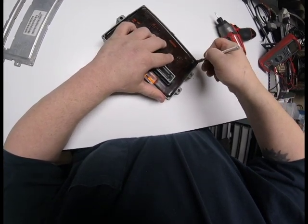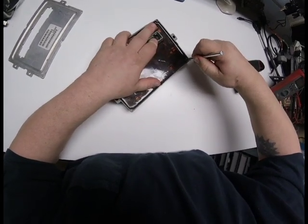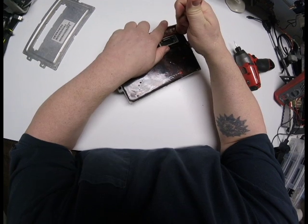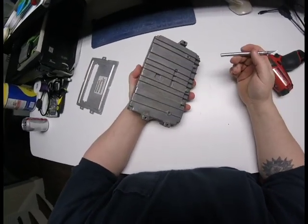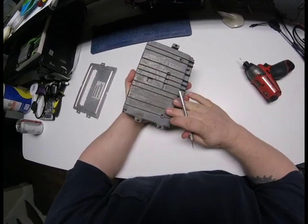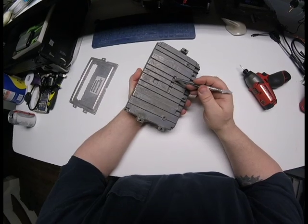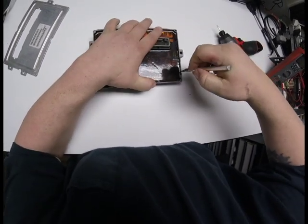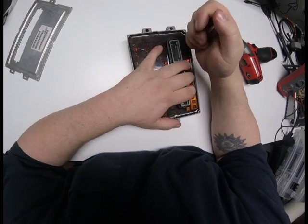Like I said in the other videos — if you watched them — do not go and cut a big hole in the bottom of these boards. You're basically destroying the part and it's never going to last again. This case is made to be a heat sink; that's why they built it this way. The common part that heats up is the memory, and that block right there rests directly on top of the memory. That's what this whole case does — it turns into a heat sink to keep that part cooled down so it doesn't fail. These blocks here go down and touch on the injector drivers. Do not cut a hole in this case — you're destroying the part. You might make it work for a while, but it's not going to last. That E-prom is going to fail again.